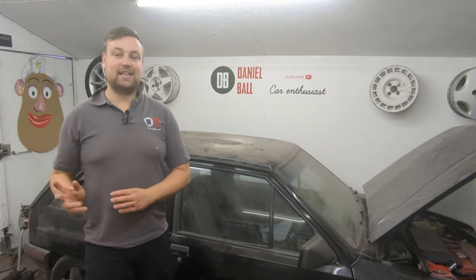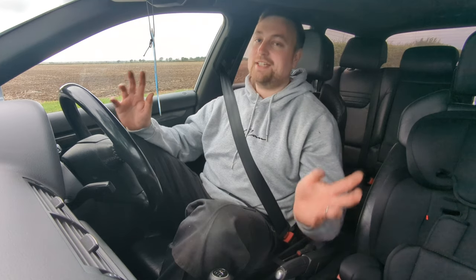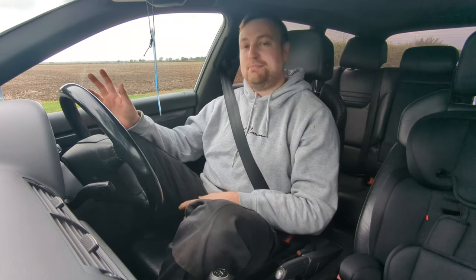Right, now I just need to put it all back together in reverse order — drop the drive shafts, bleed the clutch, all that jazz, and then we can test it. Right guys, it's back together and it's working. It's taken a few weeks — we've had the gearbox in and out a few times trying to work out what's up with it, and in the end we found the pressure plate was slightly too thick, it was the wrong one. It was a choice of two apparently and I had the wrong one. So I've put the second-hand pressure plate back in because it was in really good condition, only changed the flywheel because the flywheel was knackered. Second-hand pressure plate, new friction plate, and new release bearing — most of it's new and it feels superb. Really happy and the car's purring once again.